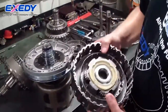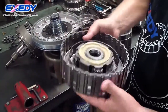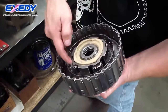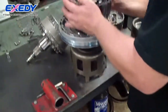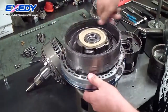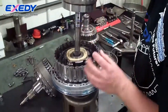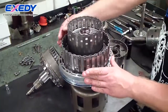In this drum, we have an example of what they call a simple planetary gear set, or a Simpson planetary gear. It has the sun gear inside of the planetary gears — it works exactly like it sounds. The planetary gears revolve around the sun gear. These planetary gears drive this ring gear, which provides another different gear ratio.